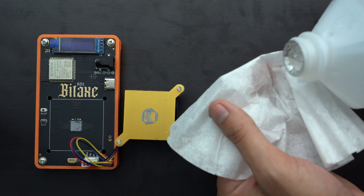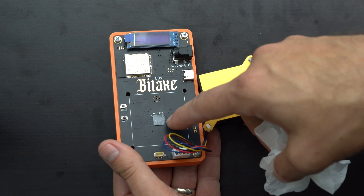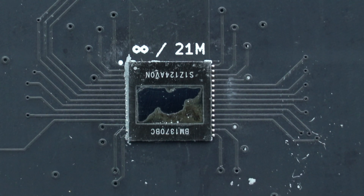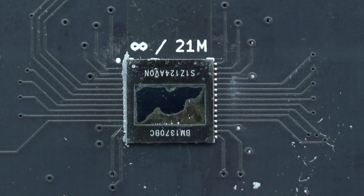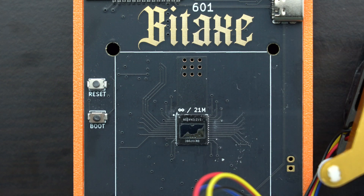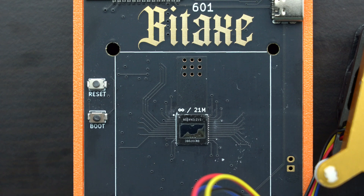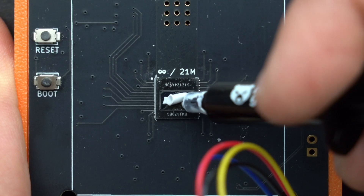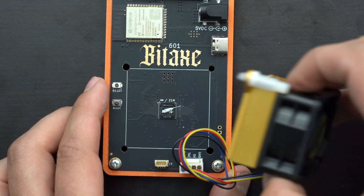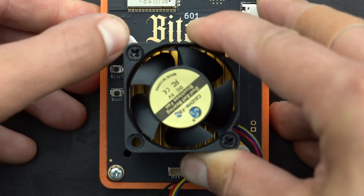Time to go ahead and clean it off. I'm going to grab a little bit of isopropyl alcohol and clean off the backside of the heatsink first to get things nice and clean, then do the same for the actual ASIC itself. Now we can take a closer look at the BM1370 ASIC that's powering this BitAxe — it's the same ASIC used in the Bitmain Antminer S21 Pros. Next, grab your thermal paste and apply a little bit onto the chip itself. There are two recommended ways to do it: either put a little dot right in the center about the size of a pea, or put a line across the chip — no wider than a grain of rice. I'll go with the line method. When reinstalling the heatsink, the main thing is to ensure you're placing it as flat as possible so everything gets spread evenly on the ASIC. Line up the pins with the holes and push them down to lock them into place. Give it a gentle wiggle to make sure you've got a nice solid connection — you want to ensure that heat can transfer directly from the ASIC to the heatsink.